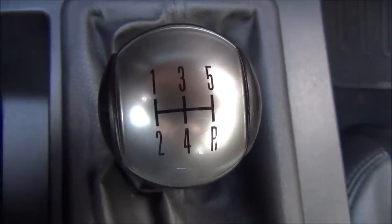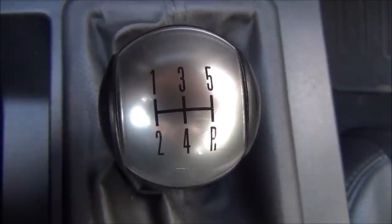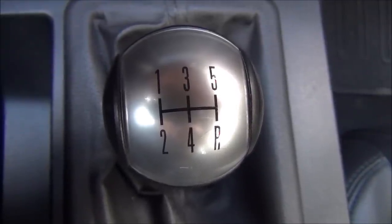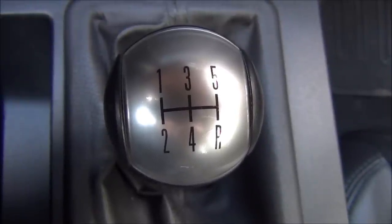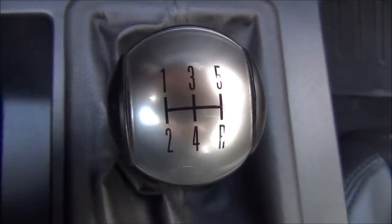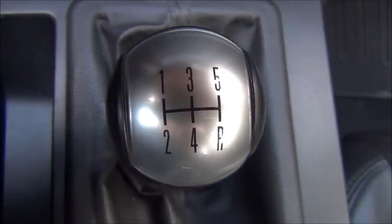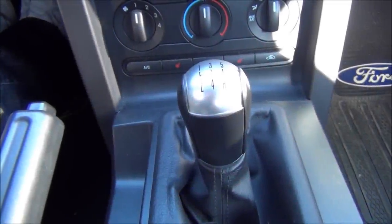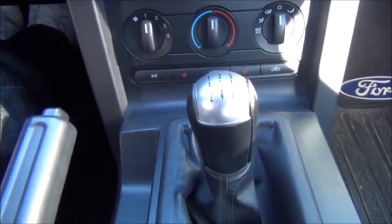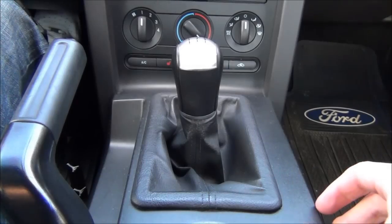Now I want to go over how to get into each of the gears. The car manufacturer has made it easier by displaying a map of the gear pattern on the shifter. First is to the left and up, second is to the left and down, third is straight up from neutral, fourth is straight down from neutral, fifth is to the right and up, and reverse is right and down from neutral. Reverse is a lockout gear — you cannot go straight from fifth to reverse; you have to go into neutral first. The shifter and the clutch pedal go hand-in-hand, so never make shifts without having the clutch depressed all the way.